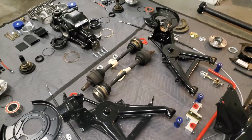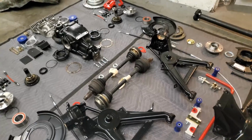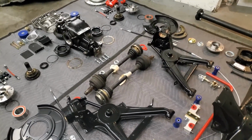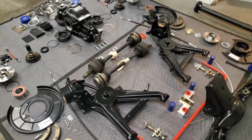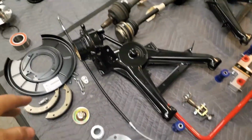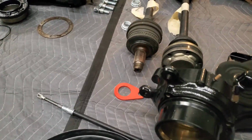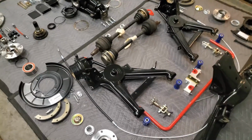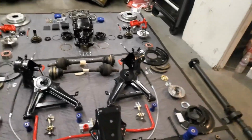Also, like I said before, I did not get rebuilt axles. These didn't look half bad and felt good, so I'm gonna continue to use them until they break, and once they break, I'll get new axles if needed. With that, I also have new e-brake lines and a Garagistics rear tie-down mount for the rear strut. So instead of wrapping around your wheel, you could wrap it around the trailing arm instead.